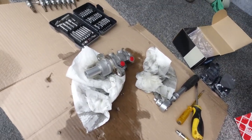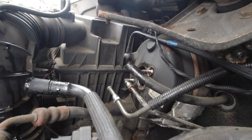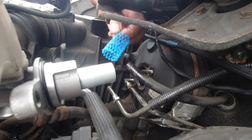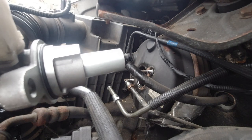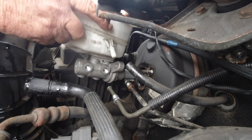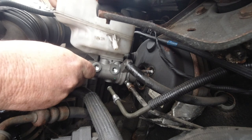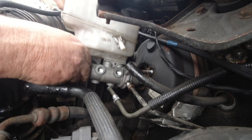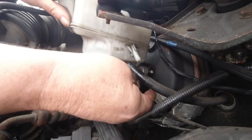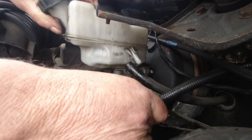I'll clear this mess up before I start fitting it. I'm having difficulty getting the camera into position. That's just a protective sleeve - put that in the toolbox. I've taken the red caps out of the brake cylinders. You've got to get it lined up in the centre of the servo, at the same time as trying to get those pipes just inside the holes.